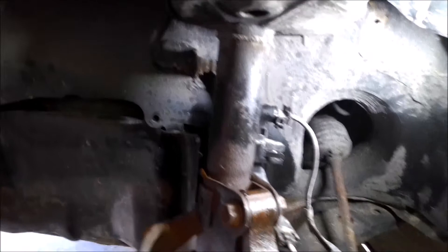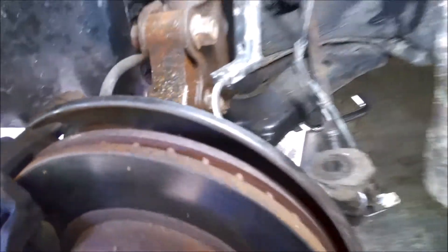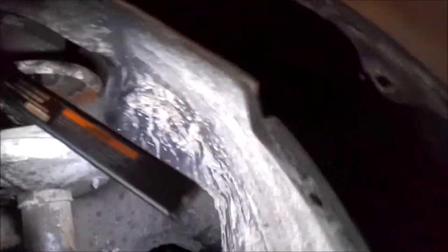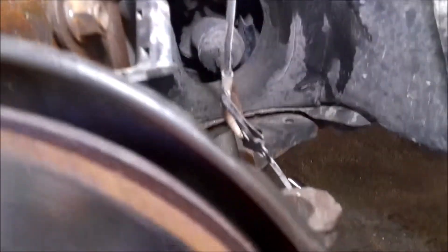We'll put this rotor back on and put the brakes back on, tie rod, and speed sensor. Hopefully you had your brakes hanging up — go ahead and put those back on. You got the two 17 millimeter bolts in the back that hold this entire caliper unit onto the rotor, so that's all back in. The speed sensor goes up to this mount on the strut and then up behind this fender well. There are about five or six 10 millimeter bolts back here. The speed sensor comes up through here and goes behind this wire harness and hooks in right here. Just be aware of that if you end up changing the whole hub and it comes with the speed sensor.